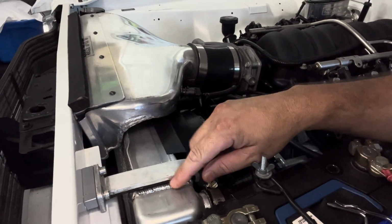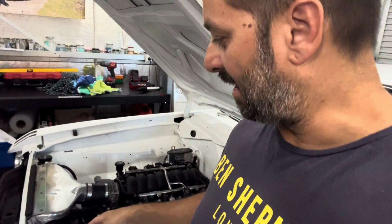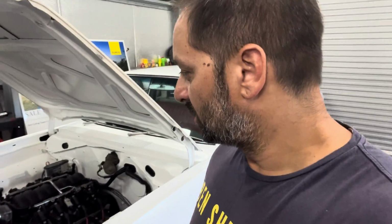Also, my mate up in Bundy, I'm from Bundaberg originally, Mick McDonald, shout out to you, Bruss. He actually suggested this radiator, which is an eBay radiator. He's put that in a lot of tough Mopars and never had any heating issues. I mean, nearly every Mopar I've had has always kind of heated up, mainly on the highway, which is kind of odd because most cars overheat around town. So I got that eBay radiator, and also the Falcon EL twin thermos. That radiator and EL Falcon thermo combo works an absolute treat.